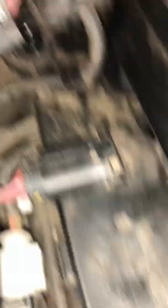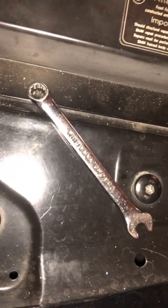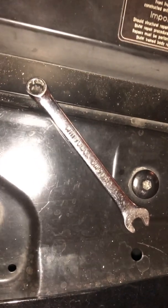Front of the engine, rear of the engine — we're trying to reach that sensor. Here's the wiring that comes through, and that's the connector right here. It's a little push and it goes in. There are just two screws back there. I use a 7mm wrench in order to loosen the two bolts holding the throttle sensor.